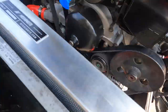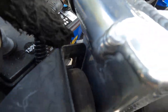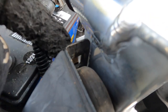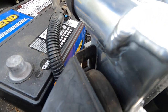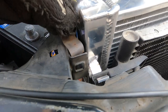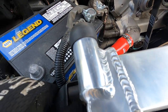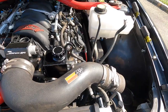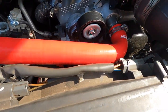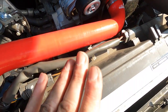After customizing the custom parts, finally got the radiator in — nice! Can't really show the bottom but it sits flush now. There was also a small bracket rubbing against the radiator, so I just took a hammer and tapped that bracket over to create a gap — don't hit the radiator itself. Last thing is to clip in the top retaining clip and we're done. Pro tip: if you're mounting the fan after the radiator is in, remove the lower hose first because it gets in the way — gives you plenty of room to slide the fan shroud down.